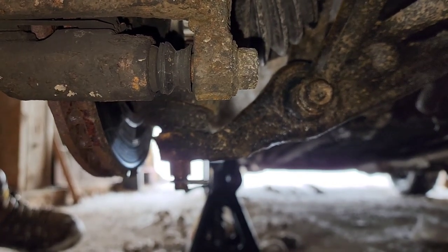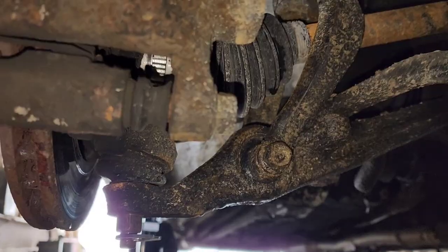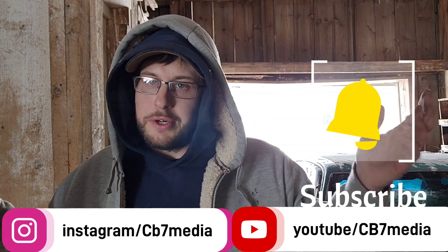Always make sure you follow up on your mechanic's work. You shouldn't have to, but sometimes it's just a necessity. Make sure that your front end is safe and that you have cotter pins in your ball joints and tie rod ends whenever you replace them. If you have it done at a shop, go back and make sure that everything is tight, torqued correctly, and the cotter pins are there. Because sometimes shops can be lazy — not all of them — but there are some fly-by-night shops and fly-by-night people. So just keep safe and stay up-to-date on all your stuff.